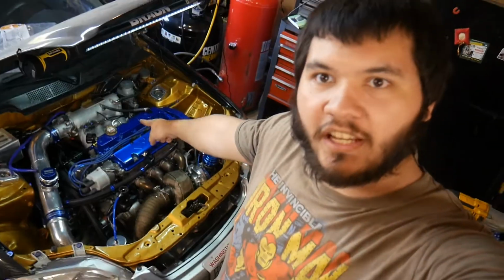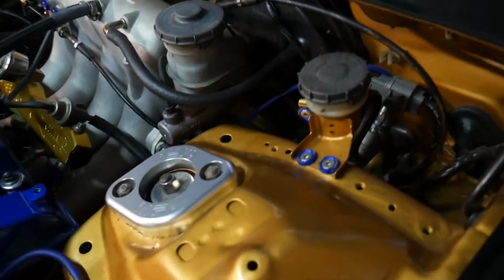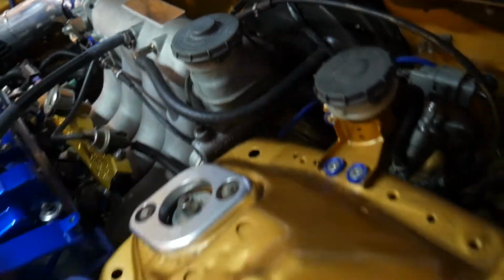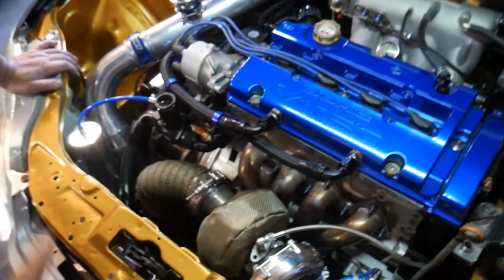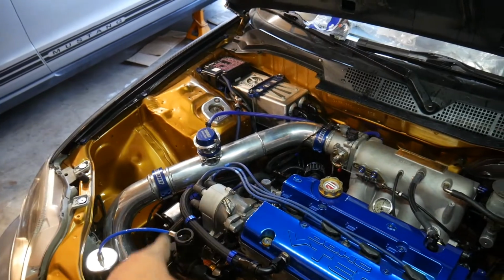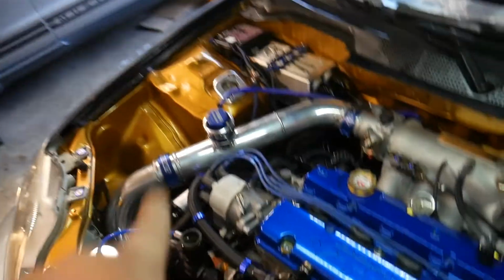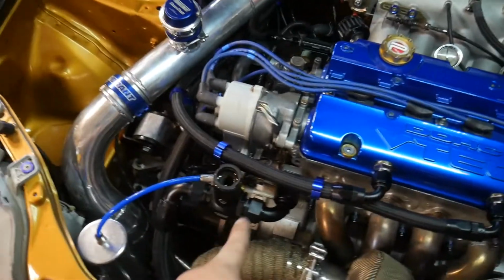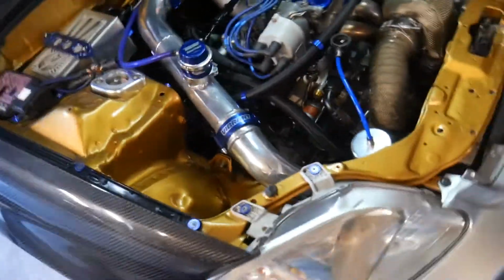Yeah. What's up, guys? We finally got the Honda running. We worked out some of the issues that it was running into. One that was making the idle surge was just this little vacuum hose that connects from the manifold to the brake booster. We added some coolant back into it. Apparently we had the wires wrong for the coils, so we had to switch those around. What else? We had the water temp and, well, we just had two wires switched around. So there was that.